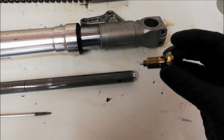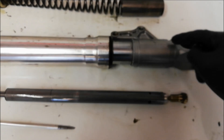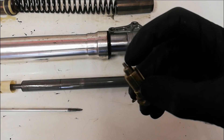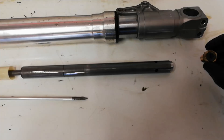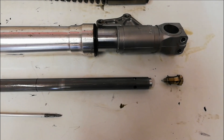The really interesting bit is how you adjust them. This is the compression adjuster, which on these Ducati forks bolts into the bottom of the fork - on a lot of bikes the adjuster is around the back of the fork, with an oilway drilled in to divert the oil. When you close the damping off, you're screwing this taper into a hole, which blocks it and forces all the oil through the shim stack. As you open it up by winding out the screw, it affects how far the pin goes into the hole and how much oil can bypass without going through the shim stack, thus changing how much damping you have in that direction.